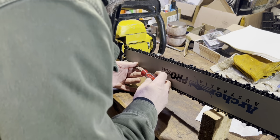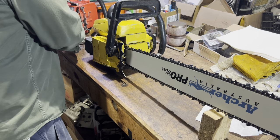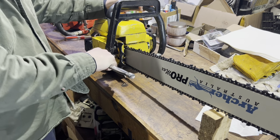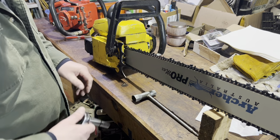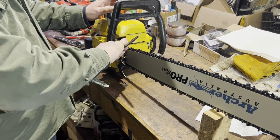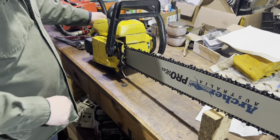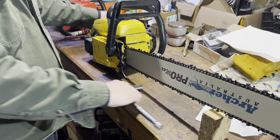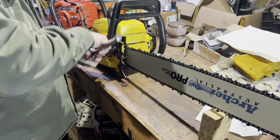I am going to have to tension this again after I run it because it will stretch. When I tighten bar nuts, if I'm using a saw wrench — a lot of people call them scrunches — what I'll do is put my thumb on the end and that's the only torque I give it. I won't give it any more than that. If you come out further, you can put too much leverage on it — the further you are away, the more torque you're going to put on it and you can break studs, pull them out of cases, strip them out. On this saw I use a socket because the saw wrench doesn't fit well because of the brake handle, so that's why I'm using a ratchet and a socket.